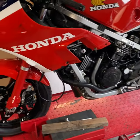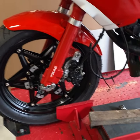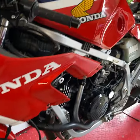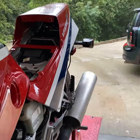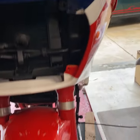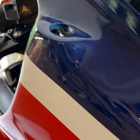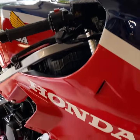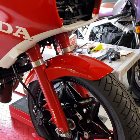The final stages of the paint process: we'll be sanding back this clear until all the orange peel is removed. We'll then apply a flow coat, which is another layer of clear coat, and once that is cured, we'll cut that clear coat back and polish it to a mirror-like finish. But that will have to be covered in another video in this series.